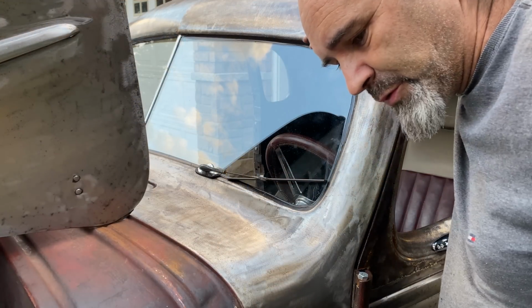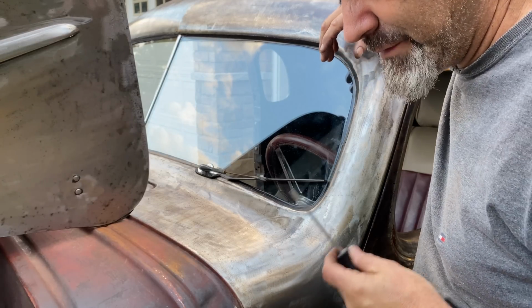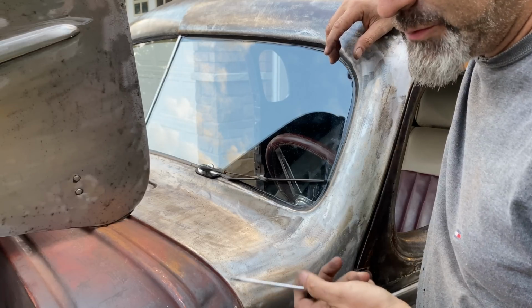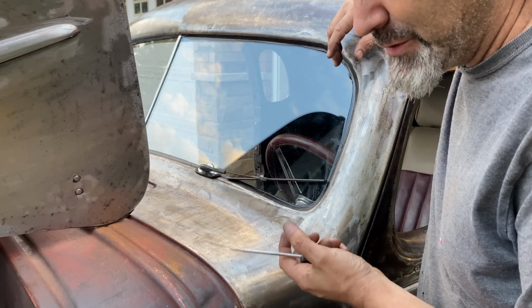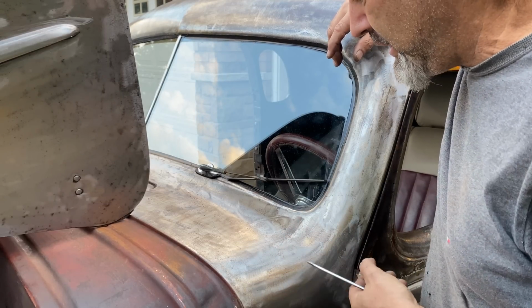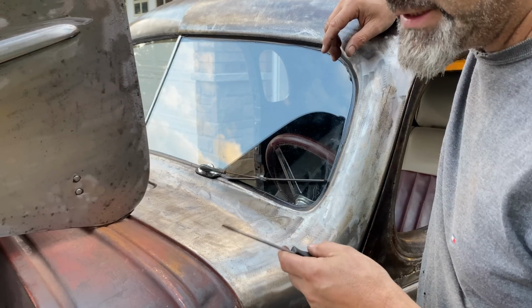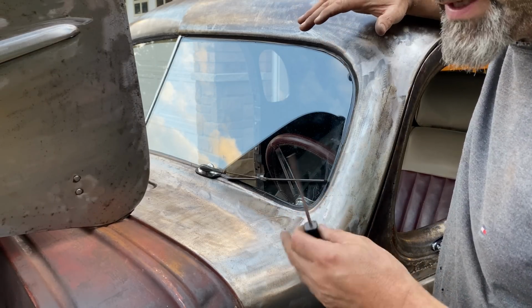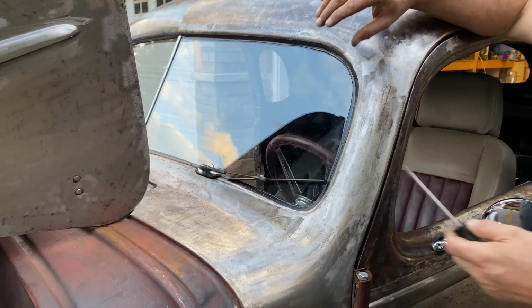Well, they almost work. And I think the problem is I need to take the vacuum off of the manifold. I was really just experimenting with, you know, the vacuum off the carb, and I just don't think it's enough suck. But the other thing I'm going to try before I give up for today is I'm going to reduce the idle, because I think it's running a bit fast, so it's not getting as much vacuum as it should. So one more go.